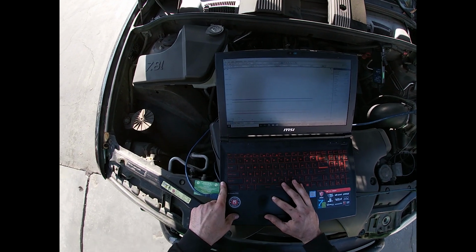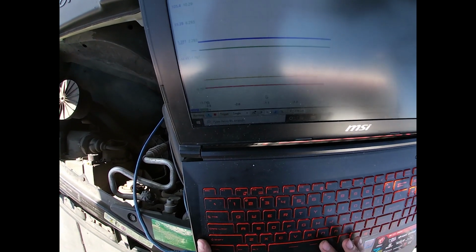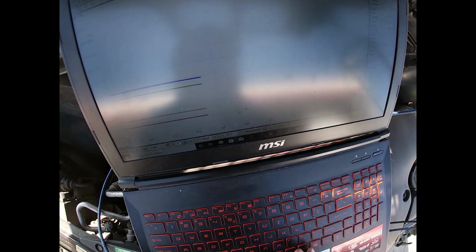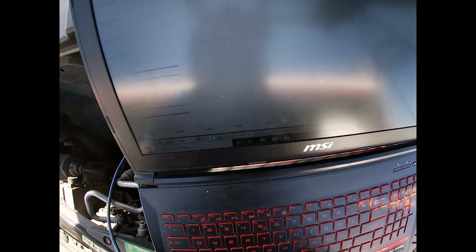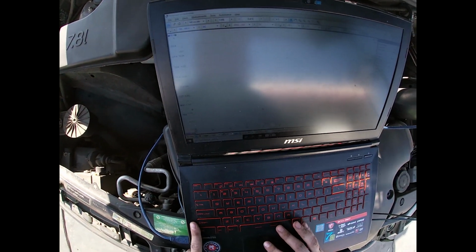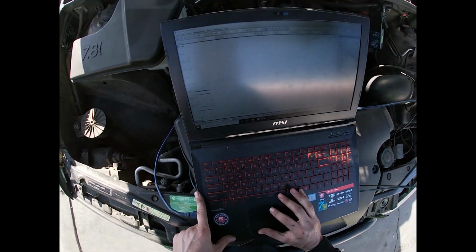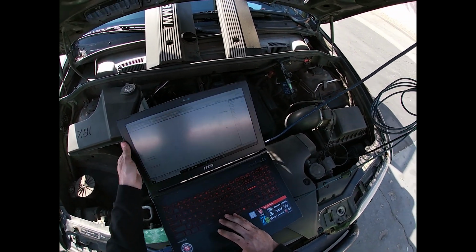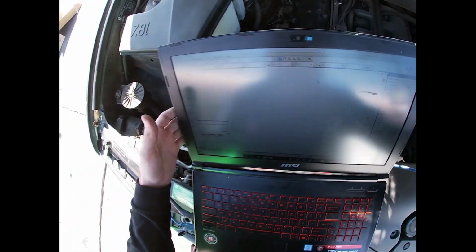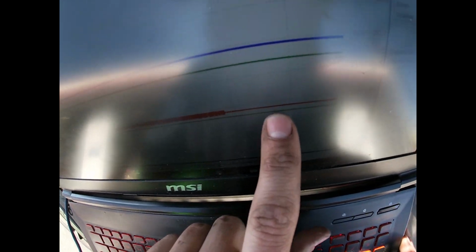So we're zoomed out. I'm going to put a trigger, single, B. Here's my trigger. Move it over here. Put 10. And it's at 300 amps. That's fine. Change to 1000 amps. Turn it on. Here's it zeroing out, calibrating, and we're zeroed.